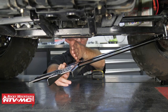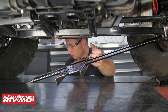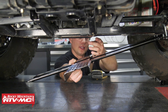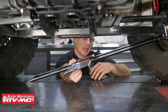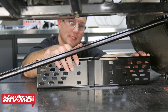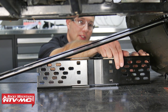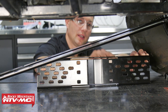For the rear mounting bracket, the U-bolts need to be between 10 and 25 inches from the front mounting U-bolts, and typically this is going to be underneath your foot pegs. To get the U-bolts around the frame by the foot peg, we're actually going to have to drill a hole. The manual wants you to use a 23-64 drill bit; if you don't have that — it's not that common — you can use a 3/8, which is just one step up. One side of our frame is sticking further out than the other, so on one side we're going to use the outer mounting slots, and on the other side I'm going to use the inner mounting slot and flip the bracket over to get it more towards the front of the machine.